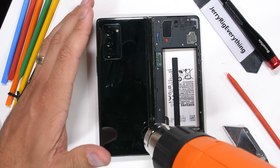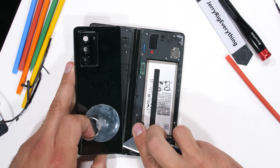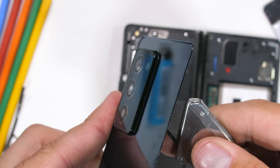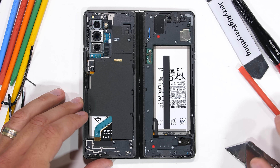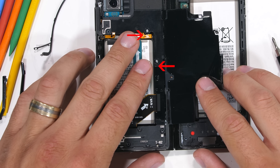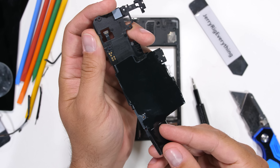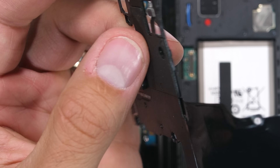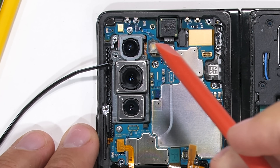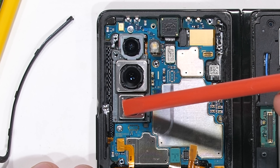We head over to the only place on this phone without a screen. A little more heat and slicing removes the back glass — it comes away in one piece. It's got a small microphone on the back camera lens, either for better video audio or just for noise cancelling. With the exterior removed, we can now see the 24 visible Phillips head screws and the additional two screws hidden up underneath the wireless charger. With the screws all gone, we can get the wireless and reverse wireless charger removed — it communicates through little circle pads that rest on top of the motherboard. We can then unplug the battery. My Z Fold 2 5G is missing the internal 5G millimeter wave antennas because not every version of the Z Fold 2 5G will ship with those installed.